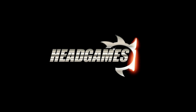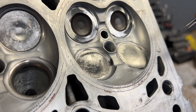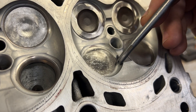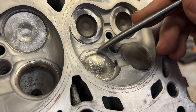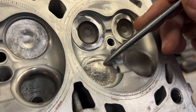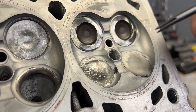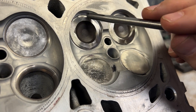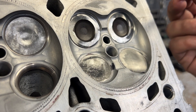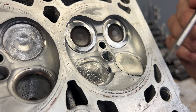All right, it's chamber time. People get a little freaked out about reshaping chambers in a di port, but I've had no problems with it. What we're going to do — you see there's a lot of sharp edges around the exhaust all up in here. This particular head, or its brother, has issues with cracking in this area. The spark plug sits out really far and there's a lot of sharp edges, so it creates a hot spot. Over here too, this is going to create issues where it's just not going to flow very well. So we're going to blend it all in — we're not going to really take a lot of material out, we're just going to soften the whole thing up.